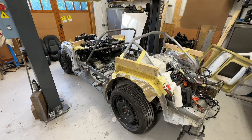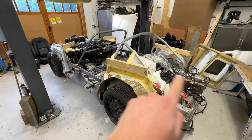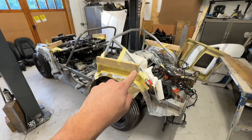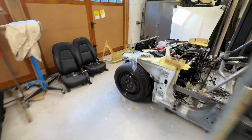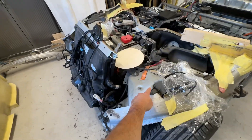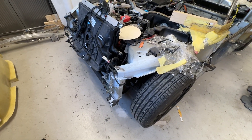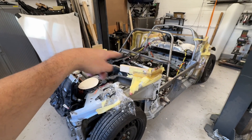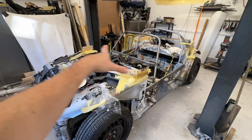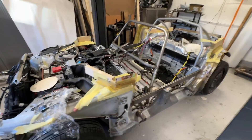This feels like we're getting to the point where the body will be properly mounted. I've still got some steel mounts I want to come off here to support the body - I'll probably go off the roll cage up to about the distance of the end of these shotguns, and similarly for the front I'll come off near the strut tops, around here up to here, and bolt into some now-unused fixing points down at the front. Then carry on working out how I'm going to package everything in this region - the demist vents, the windscreen wiper, dash vents - there's lots of stuff that will be a lot easier to do while the body's off.